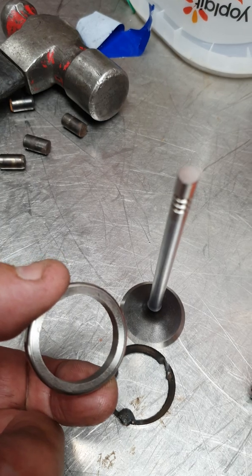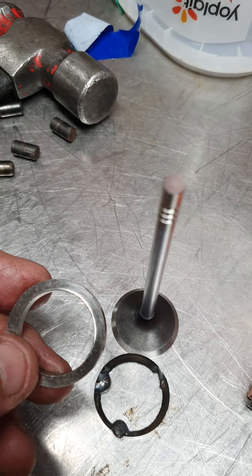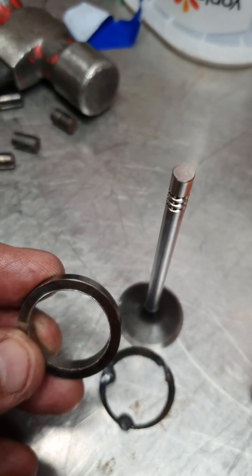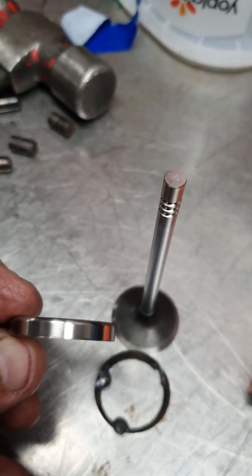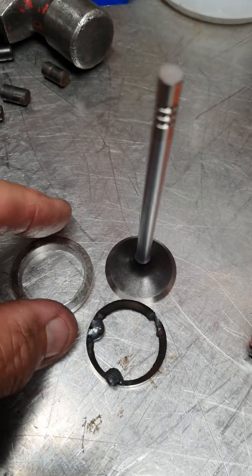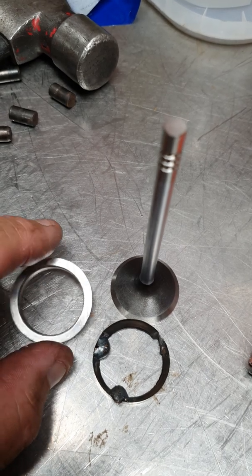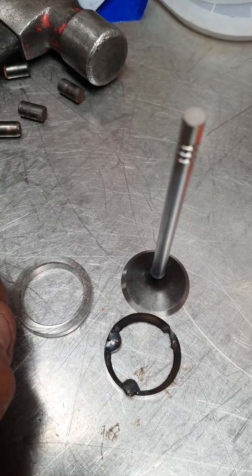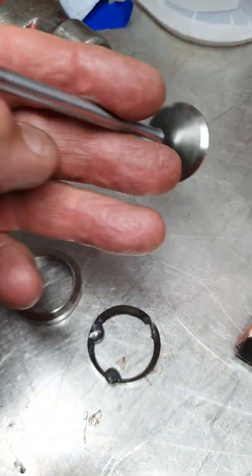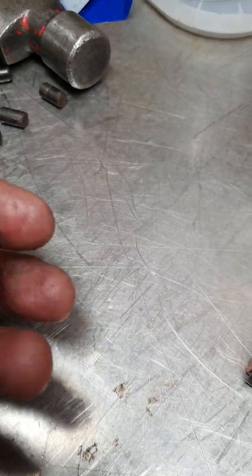The inlets I leave — they've got enough body in them. When I'm going to an oversized exhaust and an oversized inlet, I will put bigger diameter inserts in the inlets as well — that's one of my high-end Barra heads. But this particular one's just having a standard valve, so we're fitting the more durable type insert with a CNC throat to get maximum airflow out of the seats. And that's the rundown for the FG head Barra modifications.